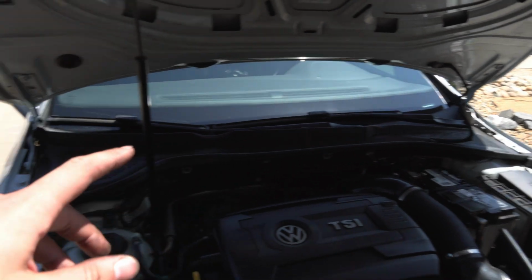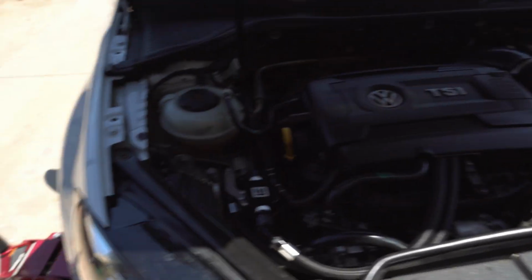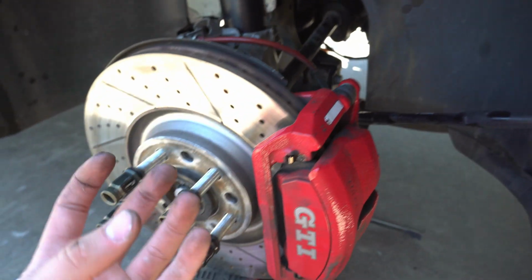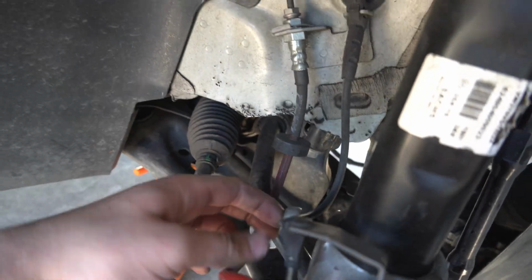Okay, the cowls all snap back together. Bolts are torqued to 22 foot-pounds or 30 Newton meters. So now we can go ahead and bolt the rest of the car back together. Start with that rear strut bolt, and then the bottom control arm bolts. There's 3 of them.